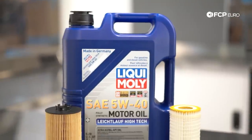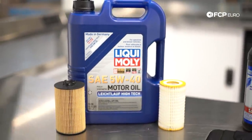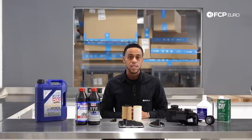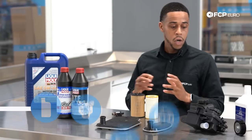8-cylinder cars will require 9 liters. If we're talking the M156 platform, you definitely don't want to use a viscosity lower than about 5W40. Keep in mind that Mercedes essentially engineered a racing engine for these applications. What will it cost you to change the oil on your Mercedes? Approximately $85.